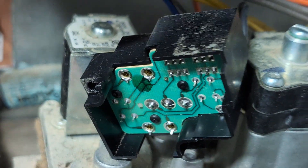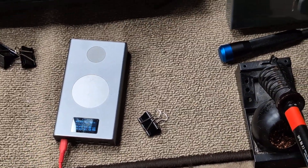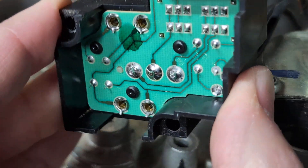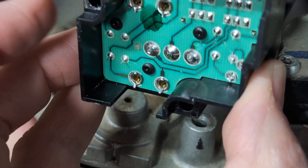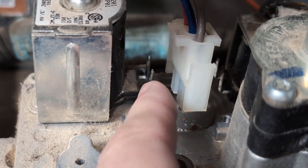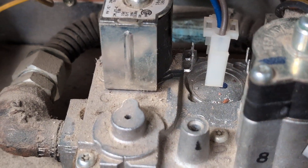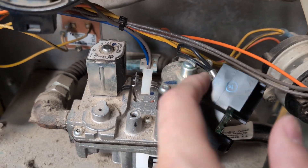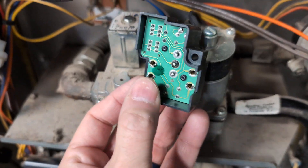What garbage. Let's reflow those. I brought my soldering iron over here hooked up to the battery pack, and I'm just going to reflow those three joints. It looks like the two outside ones are bad. I also notice the way the little module connects to the two solenoids — there are two pins there and two there. I think this has three solenoids; there's this one as well connected through these wires.